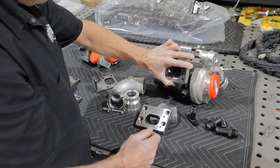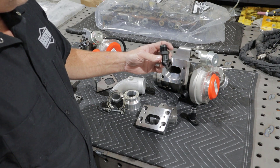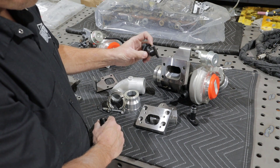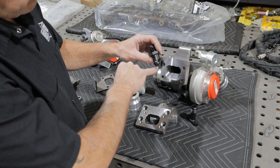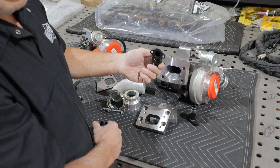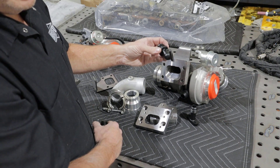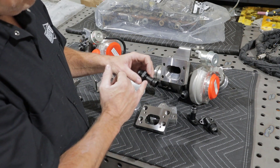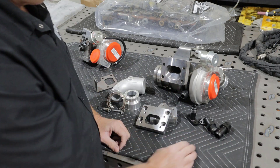So we have these 12AN fittings. On the block or pan side, we have a 606 fitting — this should also work on a 602 or 603. We've mirrored the geometry of the stock fitting. If you just have a fitting screwed into a bung or a bung welded on flat bar with a 12AN fitting, it's not as smooth of a drain transition. With this fitting, you eliminate the cost of a bung, a fitting, and an AN fitting — you really have one part and better flow. On the 617 side, we've also matched the Mercedes part to fit into the rubber grommet that goes into the pan. It's a standard 12AN fitting across all of our Holset drains at this time.